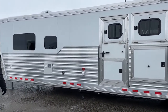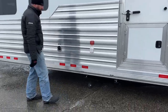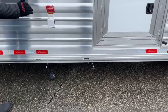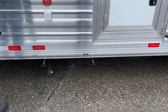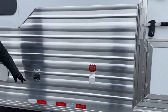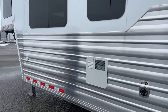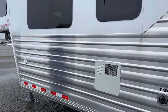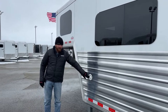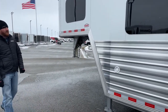Working forward, you have your dump tanks: the black tank and the gray tank. Always go black tank first, then gray tank when dumping with your hose — the gray will flush anything left in the tube. The 30-amp cord plugs in here, along with the city water connection. When you're hooked to city water, it'll bypass your fresh water tank so you're not using your stored fresh water — the fill for the fresh water tank is right there as well.